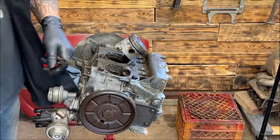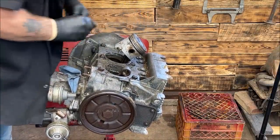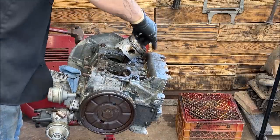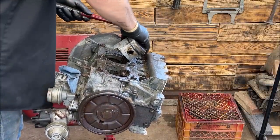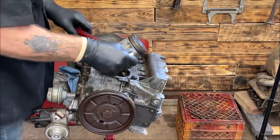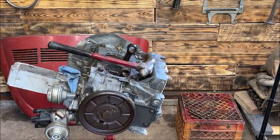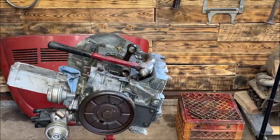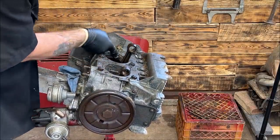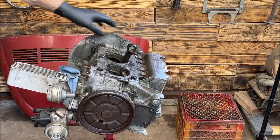Yeah, I'll bring you in pretty close once I start with pulling the oil pump and blah, blah, blah. You know the deal. I say blah, blah a lot because it's a filler. You just use it. Gently. I don't want to bang the block up there. And if you're wondering, I am using a 7/16. It fits right through there nicely. So, okay. Nice. We'll have to clean this up really well. Looks good in here. Just needs cleaning because the skirt was sitting there.